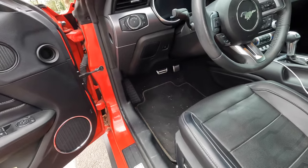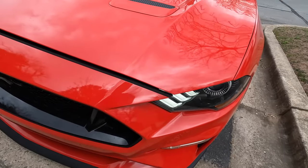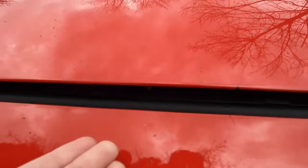You want to make sure your car is sitting on a flat, level surface — not on an incline or downhill — because that's going to cause error in your readings, which won't be fun if you're actually low on oil. First, open up the hood. We'll pull the interior latch right here to get the hood up. As you can see, the hood has opened but it's still held by the secondary latch — you can see the yellow tab — so I'm going to open that right now.